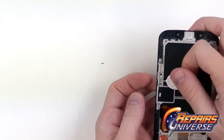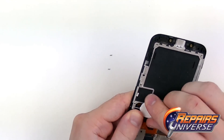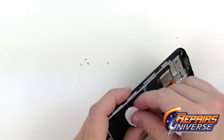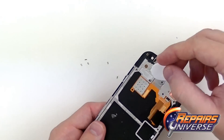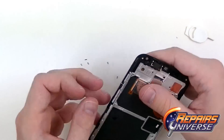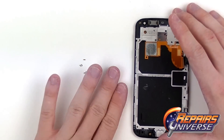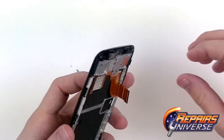There are only three pins on this side — just apply a little bit of pressure and pull each one out. Then swap to the other side for the remaining four. The final pin is a little more tricky as it's closer to the volume button and power button, so use some tweezers to pull that one out. Now that all seven pins are released, it will allow us to remove the housing from the screen assembly.